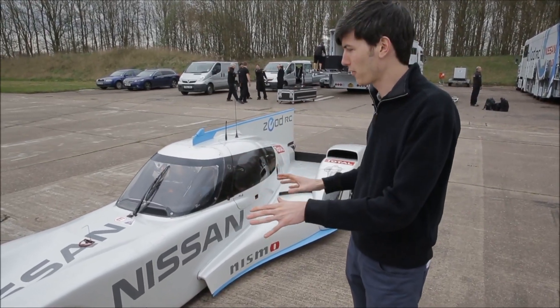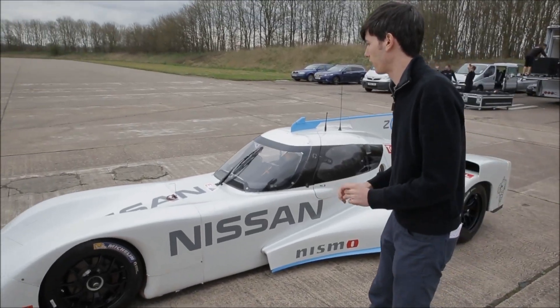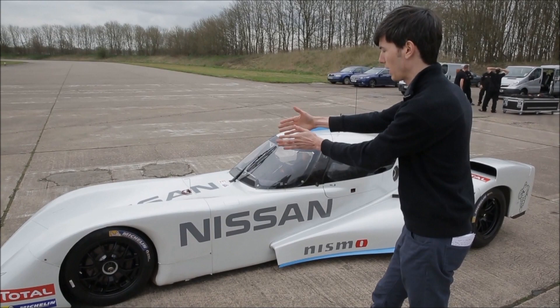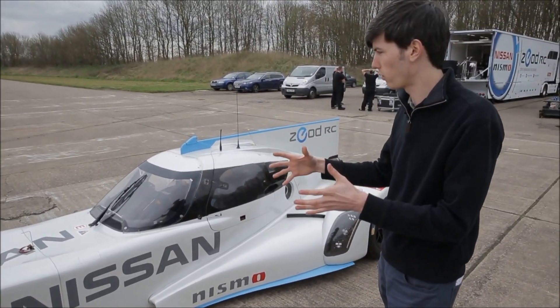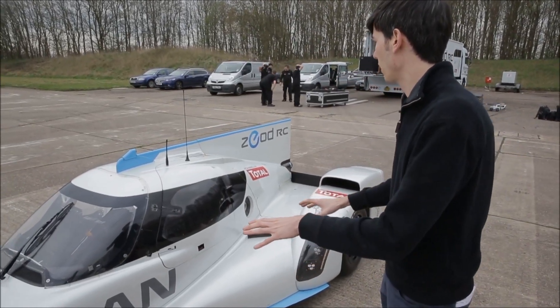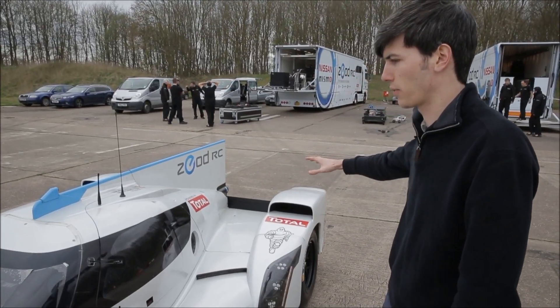So let's talk about the car. One of the first things you'll notice is the fairly unique shape it has, and this is done for several reasons. First of all, you're going to have an aerodynamic design with a very narrow front end. With it being pretty narrow, you can remove quite a bit of weight and keep the weight down pretty low. Most of the weight is going to be on the rear tires, which are the drive tires, so that's good for acceleration.